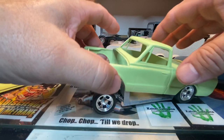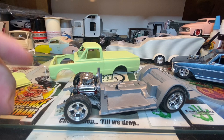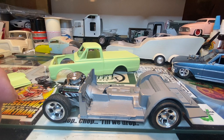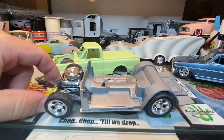I got it to where the front frame horns clip underneath the front roll pan to hold it all together. I sanded down the spot where the driver's seat would fit — all the raised portions where the seat tracks, roll cage mounts and everything would be — I ripped all that off, shaved the same thing off the other side, and cut the roll cage away. To keep a streetable look, I'm going to put two bucket seats in there and just leave it a bare interior. I painted the floor silver just to have a little silver on the floorboard.